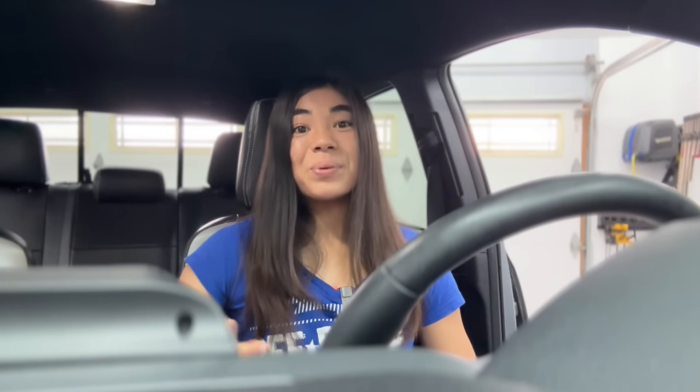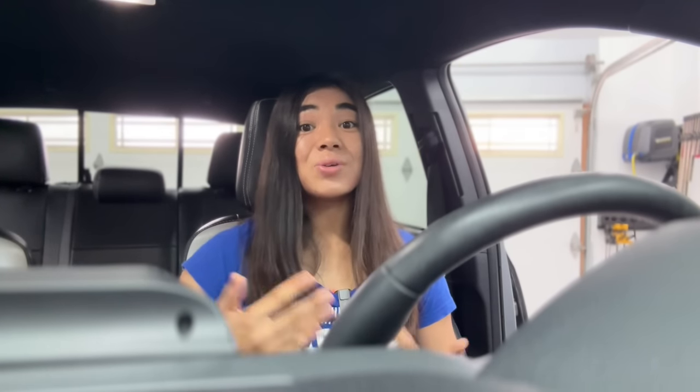My best educated guess is that Toyota did this to make everything foolproof and prevent large amp draw while the truck is in motion, to avoid strain on your alternator. That said, I'm of the opinion that not being limited to 100 watts while driving is really nice. Just generally be aware of how many watts your device pulls and use common sense — don't overload it. Don't exceed the limit. For example, don't plug in your fridge and your new interior outlet at the same time as power tools or a crock pot into your bed outlet, especially when the truck is in motion. Only install modifications you're comfortable with, but I personally see a lot of use for this one.